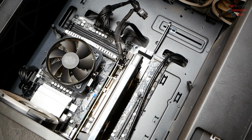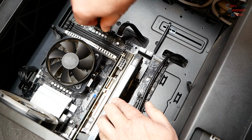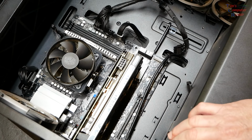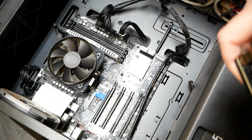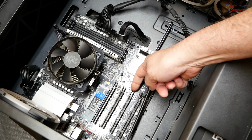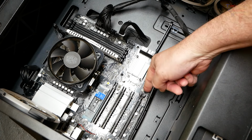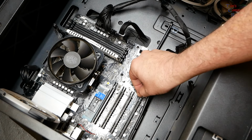I think what I want to do next is remove this video card. Drain those capacitors here real quick. I want to remove this video card. Clear the CMOS. See if that makes any changes. Wow. Look at that. There's nothing here to latch the video card in with on this motherboard. See how these have these? These are supposed to be on these, and there's nothing on all 3 of those.